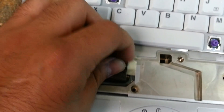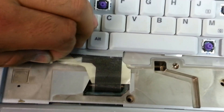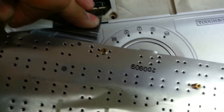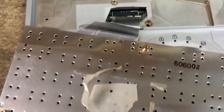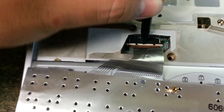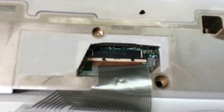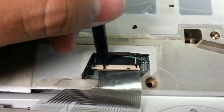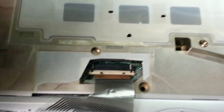Just work at it and peel it off. Then you'll be able to get back here and actually remove it from the ribbon cable — which again, if you're replacing this because it's bad, it doesn't matter. To release the latch or clip that actually holds this, get your plastic spudger with a pointy end, get it in here — there's a little groove here. It won't focus that tight in close-up. Just gently push out, and then with your pry tool just work that cable out.